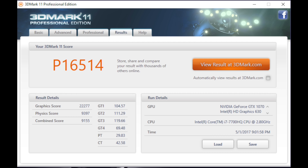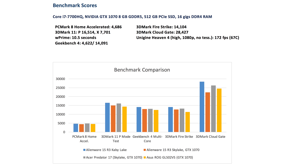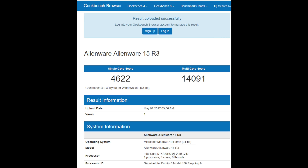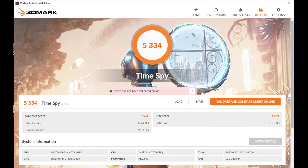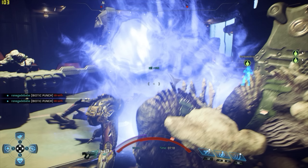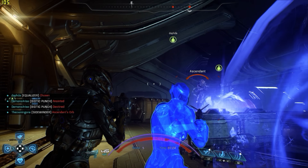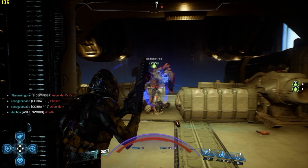Performance on this is strong — the improved thermals really help. We saw better benchmarks than with the Skylake model from just a few months ago, and it's not because Kaby Lake is much faster; at best it's 5-10% faster for CPU functions. We have the same GPU, but it's just able to run full bore better. Very, very good numbers for a machine with the i7-7700HQ and GTX 1070. If you're looking for something that can run any pro app well — Photoshop, 3D modeling — this is certainly it. And for gaming, there isn't a game you can't play on at least high settings, many on ultra. Given improvements like DirectX 12 performance, I expect it to hold up nicely. It does VR too.